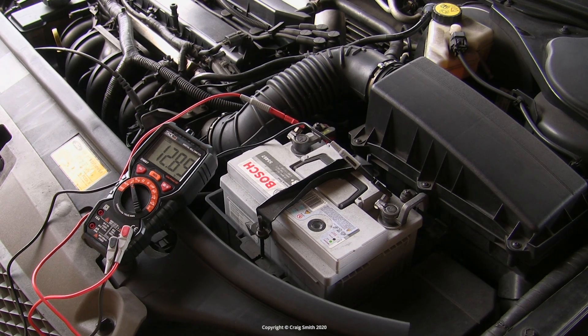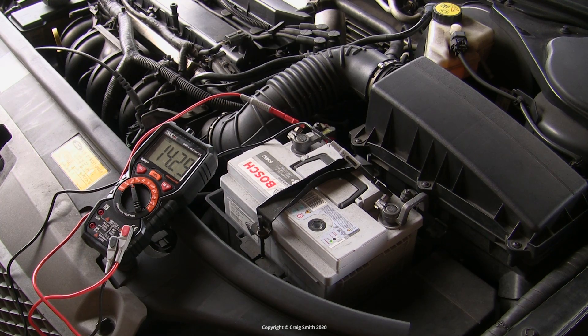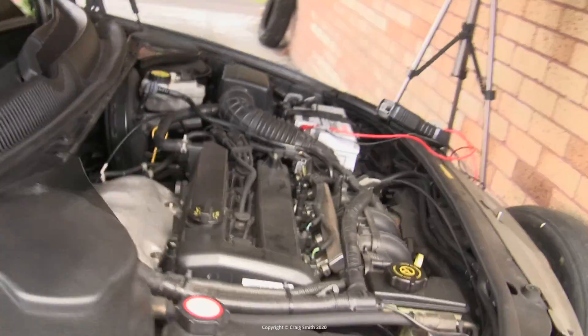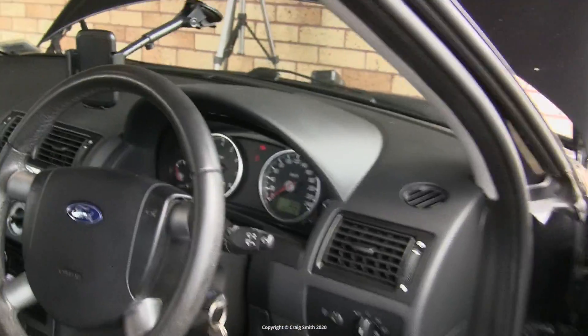Either way you want to get the engine running — jump started if you need to. You can see here I got a decent charge voltage in the battery, enough to start it. This has eliminated a number of other possible suspect components: the starter motor and all its associated circuitry is obviously working fine. And you can see this voltage is up over 14 volts straight away, which tells me the alternator looks okay. The alternator is the next most likely candidate after the battery itself, because if it's failing to charge the battery, it will just go flat even if there's nothing wrong with the battery itself.